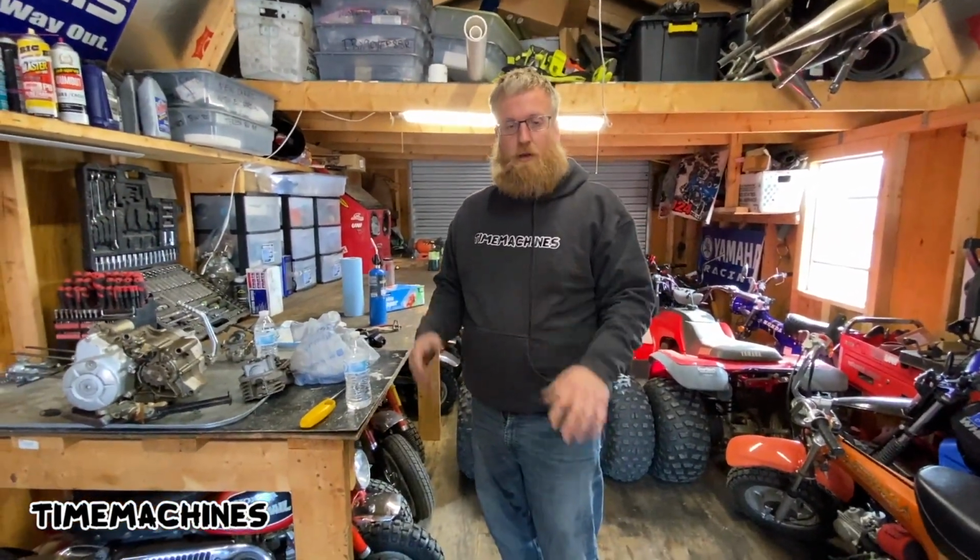I'm going to go ahead and order a crank kit. We'll rebuild it. I'm going to port the inside of the bottom end, but before I do, we got to split the bottom end. So it's going to be a minute before I even order parts, guys. We're going to get this thing out. We'll get the case splitter out, split it. We'll pull the motor out today, but we're not going to get the case splitter out today. So I'm not ordering the parts today.